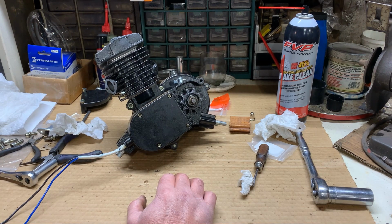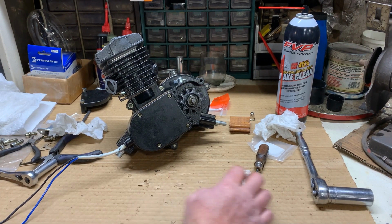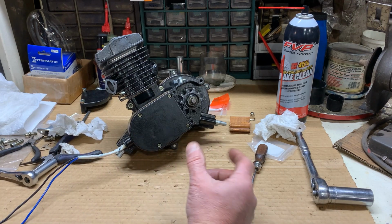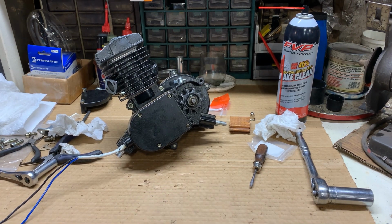All right, well, thanks for watching. I hope you learned a little bit on how to check the roundness of your actual cylinder. If you don't have the necessary equipment to do that measuring with the telescoping gauge and the mic, if you have a machine shop or small engine repair place close to where you reside, they will usually do it for you. If you take it to them, they'll take the measurements for you and let you know what you got.